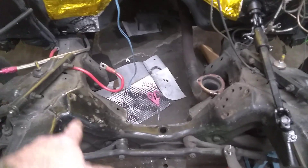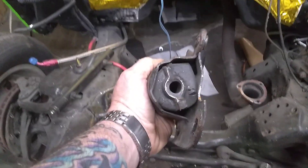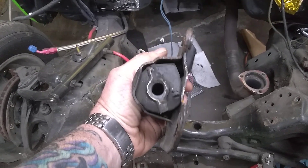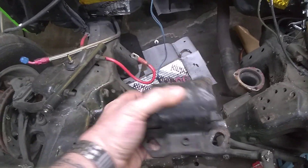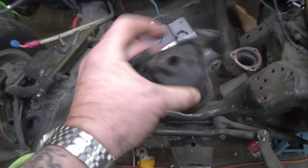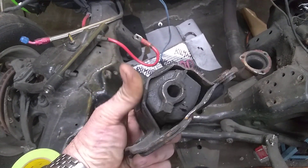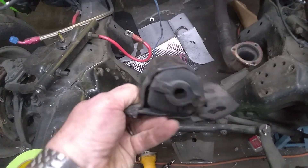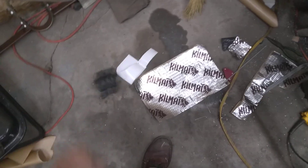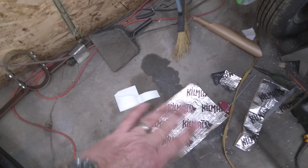Another thing: if you're going to do anything with any horsepower and you use a 2.8 frame mount, do not use a stock mount — or this kind of thing happens. See how that plate is all bent right there? The motor mount rolled around in there. That's only about 50 miles of drive time if that, and it just trashed that mount, twisted it, contorted it. You can see it's on the lift side — the torque side — where it torques up and started shoving the mount out.